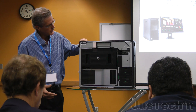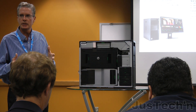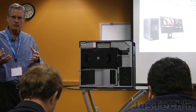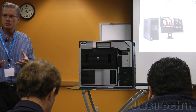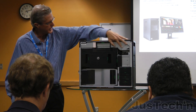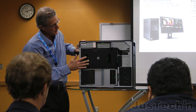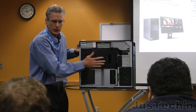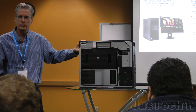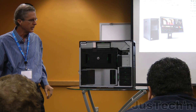This system is divided into three different cooling zones. Each one has separate sensors on the system board to individually control fans so they only spin as fast as they need to. The power supply up here has dedicated airflow through it. The middle area houses the CPUs and memory. Down below is the storage and I/O infrastructure. Each one of those is a separate cooling area.